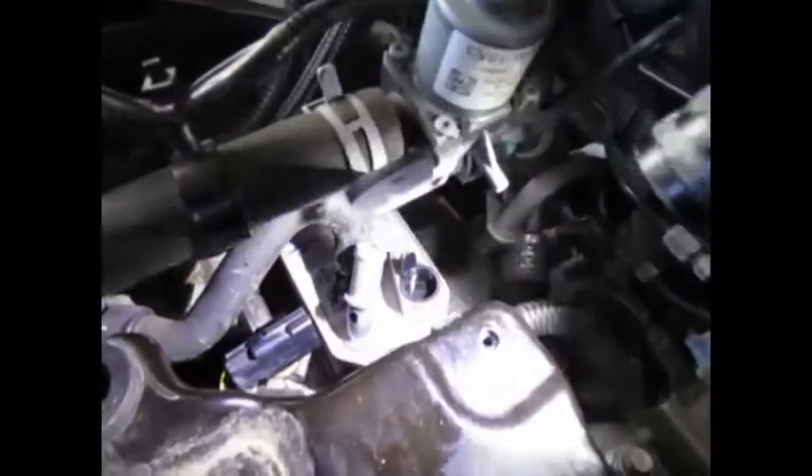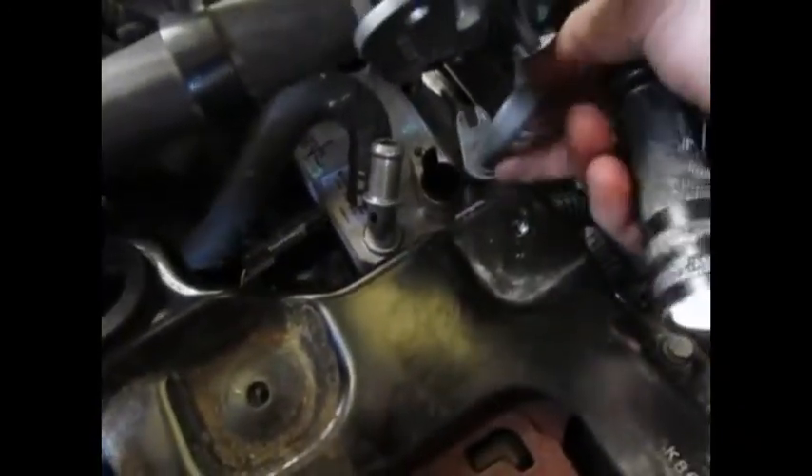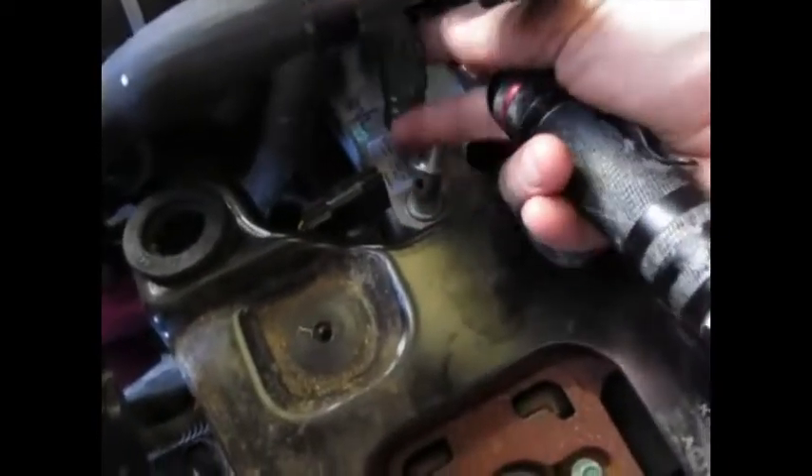You've got to come down through these wires to get to it. I have the new cooler bolted down. Now I need to connect the two transmission lines — one goes in here — and the two coolant lines. The transmission lines have a bolt that holds the fitting down with some O-rings to seal it.